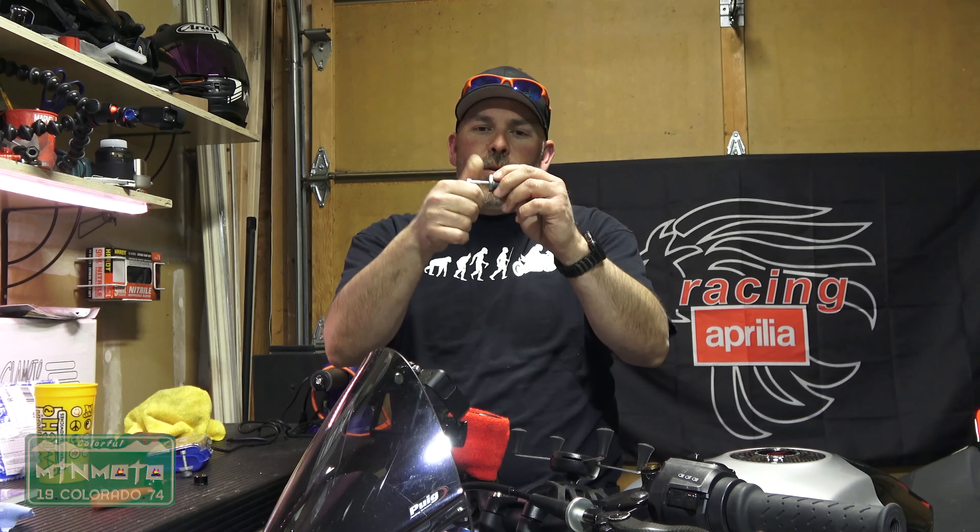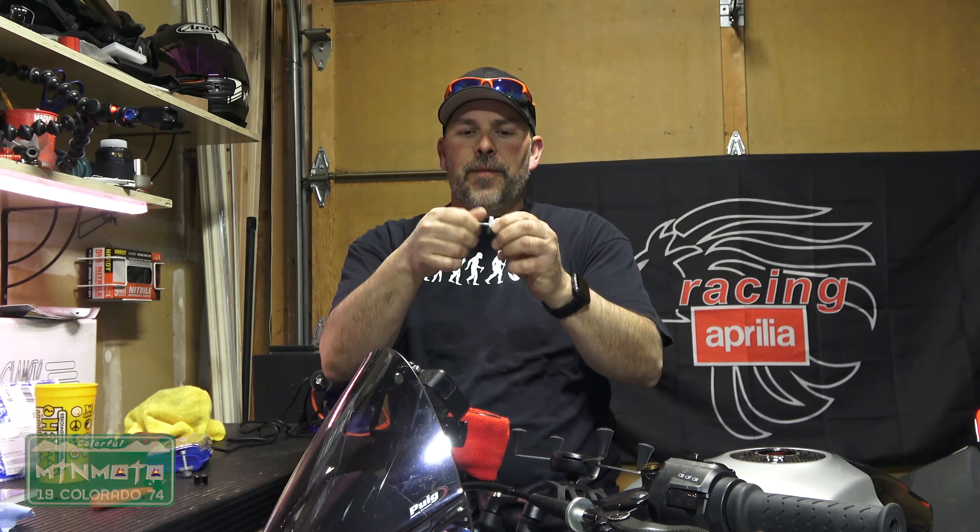Just in case, I'm going to fix it. The way I'm going to fix it is I'm actually going back to the old factory bar end weight adapter — these little suckers right here. I was originally going to paint these, and I'll show you why in a minute. I'm riding tomorrow and Sunday so these will get taken back apart and painted over the week. You want to let spray paint on anything you're going to put a wrench on cure for at least 24 hours, preferably three, four, or five days. Let it cure as long as you can, put on a few coats.